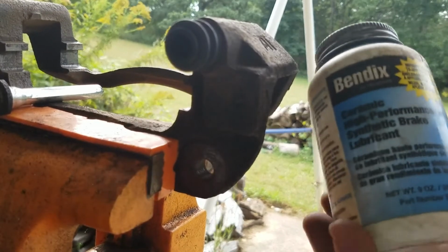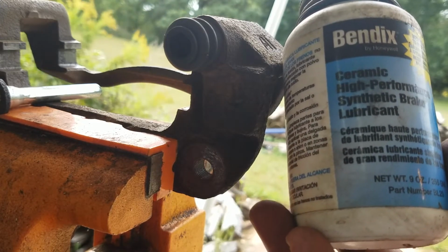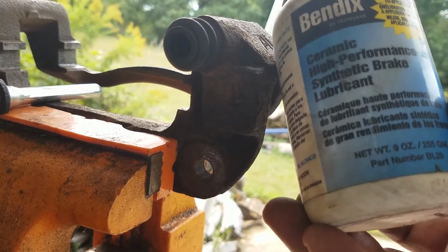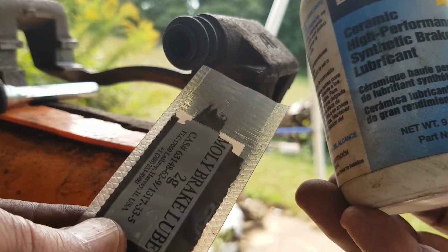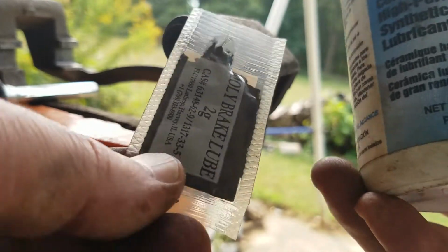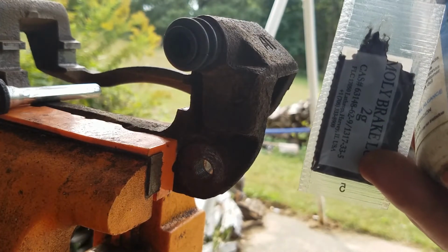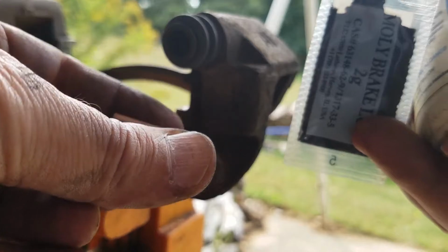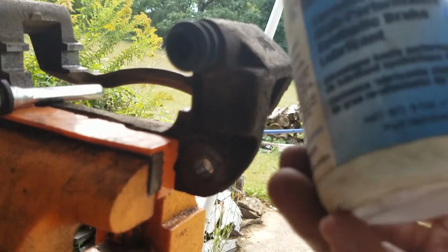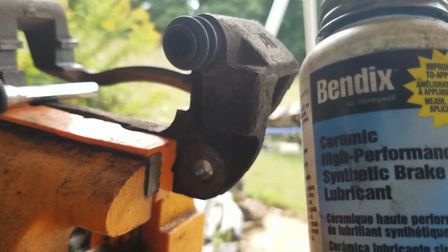Okay, here's what I've decided to use for the pins. I will use the ceramic high performance lube for the pins, and I will use the Molly stuff that they gave me with the brake pads for the shims for the steel brackets that Akebono wants me to use. So these will ride on the pads. These will ride on the pins, and I'll put links for all this in the description below.